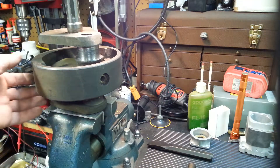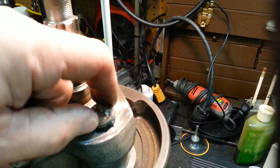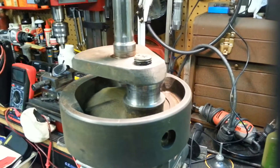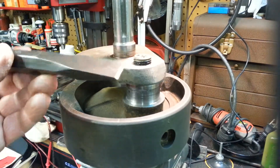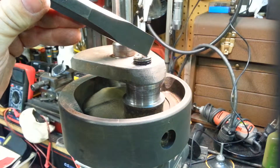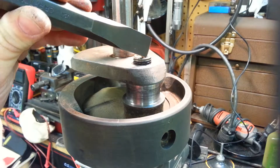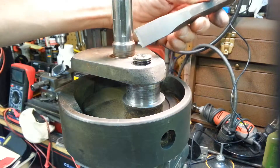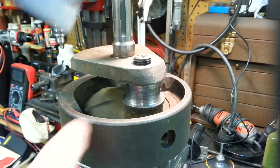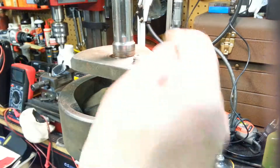What I do is take the crank off and put it on a firm surface — on the ground or a nice board. You don't want to do it in a vice. I take a nice sharp chisel, heat up the area a little, and try to catch it right on the edge, as close as I can get without coming close to the crank itself. Then I get a little three-pound sledge and whack it, come from the other side, same thing. You want the right angle, and it'll shock the screw enough to turn it. Just keep working it out both ways and it'll finally unscrew.